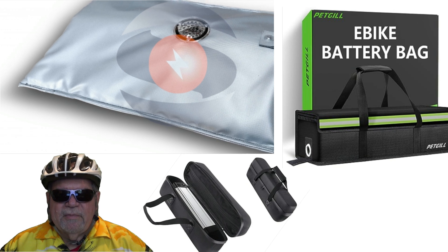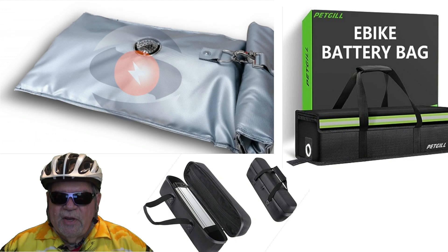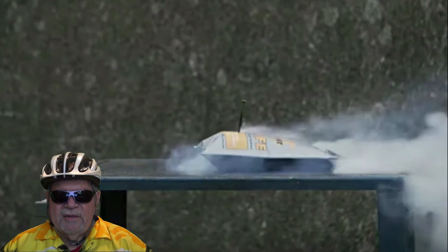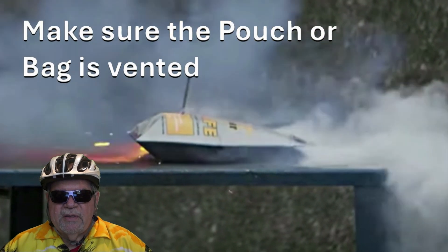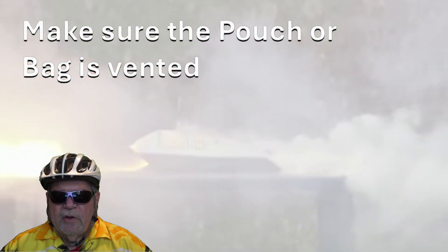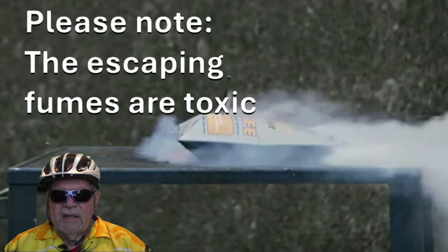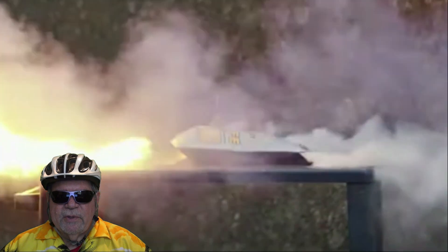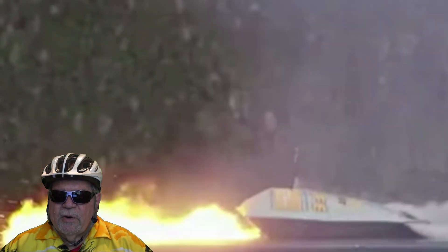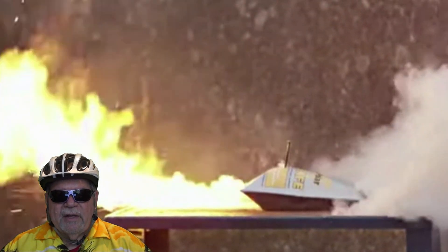The next items are fire bags and fire pouches. Some of these are better than others, but there are things to know before you rely completely on them to contain a chemical e-bike battery fire. First, an e-bike battery fire will build up pressure when it burns, so you want to make sure the bag or pouch is large enough to allow the fumes to expand and allows venting for the very toxic gases to escape. Along with that, some fire will probably still escape as fireballs. Second, most of these bags and pouches will only contain an e-bike battery fire for a very short period of time — they'll burn through and the fire can spread to any surrounding combustibles.